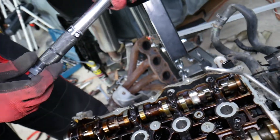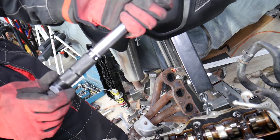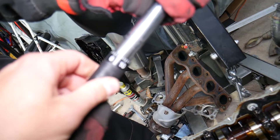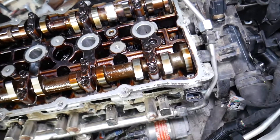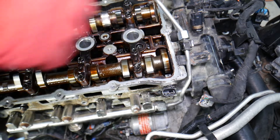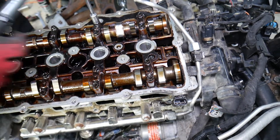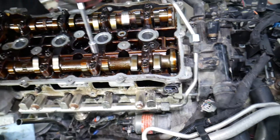For the first step, we need to set the torque to 5.9 Newton meters. We'll torque these Group A bolts until we hear a click, then stop immediately. Everything needs to be lubricated — make sure you have proper lubrication on the valves and everything as well.